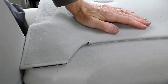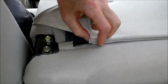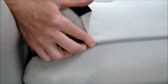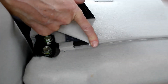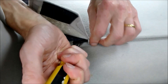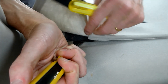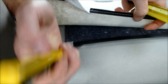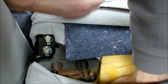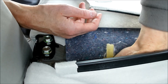Here's the back of the right-hand backseat. There's this thing here, and the trick is to lever a flat screwdriver to twist this, and then you might need another screwdriver to unhook this bit here, which eventually flips out and gives you access to the back of the seat. This is much easier than the bottom of the seat.